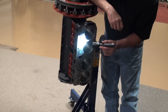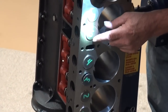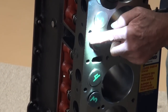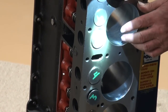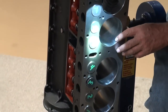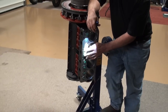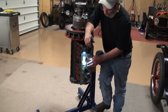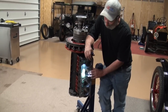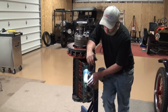We replaced the seating surface with hardened seats. You can see some remnants — a lot of water had gotten into this block and corroded it out, and we just didn't have a seat surface we could cut and grind in. So we elected, rather than just replace it with one hardened seat, to just replace them all. Hardened seats aren't necessary for valve recession because we don't have a whole lot of spring pressure, but hardened seats do clean up a defective area and according to some may help with unleaded gas where we've got ethanol in it to keep it from corroding out. Since we don't use our cars day in, day out, it might be a good thing to have a hardened seat in it.